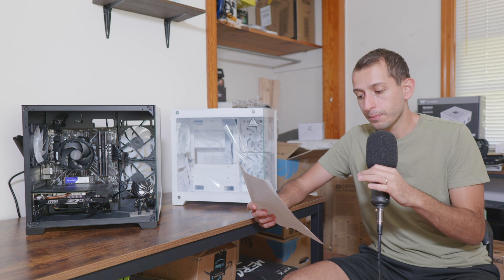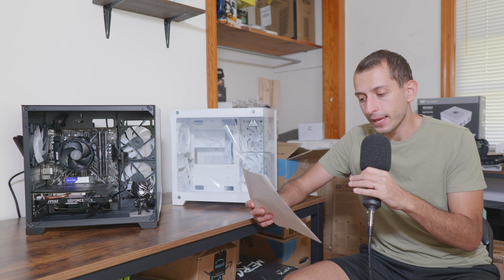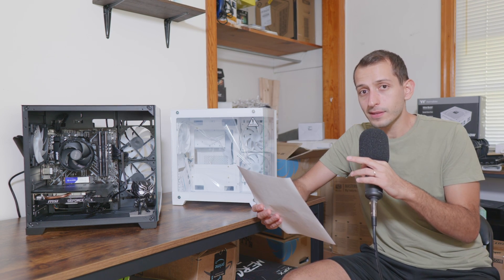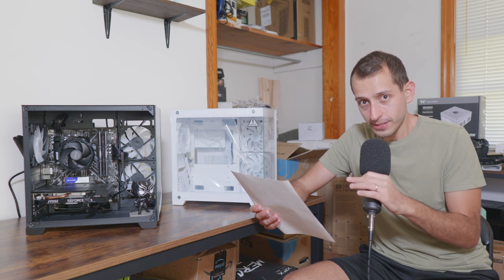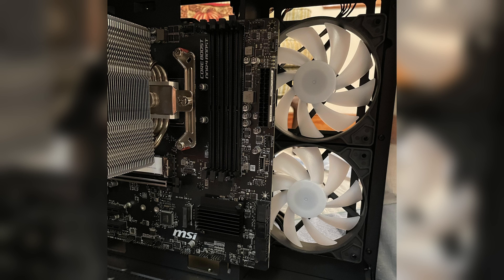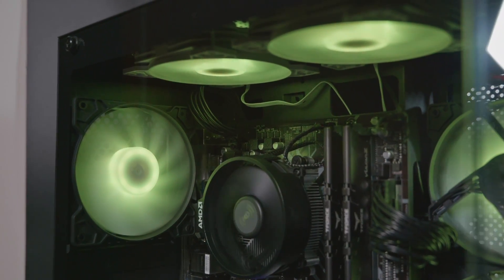Number three is the big thing to note: motherboard compatibility. It is mATX, but not all mATX. A lot of mATX boards are a shorter version of ATX — same width, just not the same height — but the boards that fit this case must be 24.4 by 21.5 centimeters, not 24.4 by 24, which is what a lot of the thicker mATX boards are. Going over the fans a little bit doesn't look great and kind of renders those boards obsolete for this case.